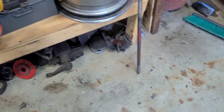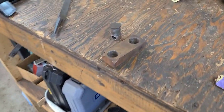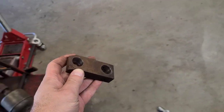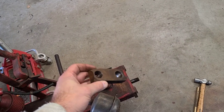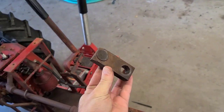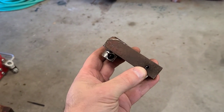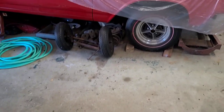This is the steering block that goes on the end of the steering shaft and sits under the frame. It has to be oriented correctly - one set of corners of the block is chamfered, so the block actually sits with those two beveled corners in a specific position. The steering shaft goes through the bottom and the trunnion goes through the top. The trunnion needs to be dropped in with the steering shaft at the bottom. The hole is filled by the steering link. Let's get the roll pin in place - it came out fairly easy so it should go back in fairly easy.